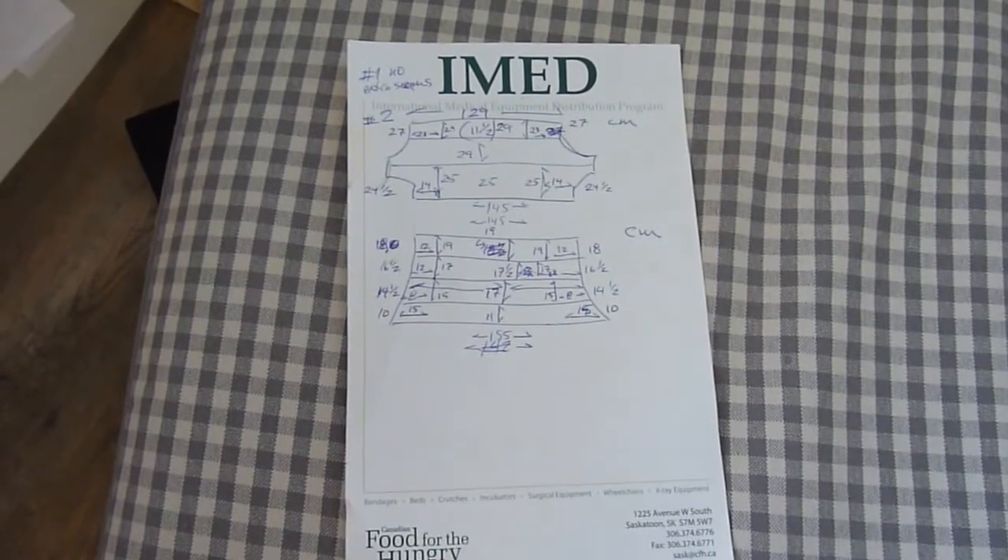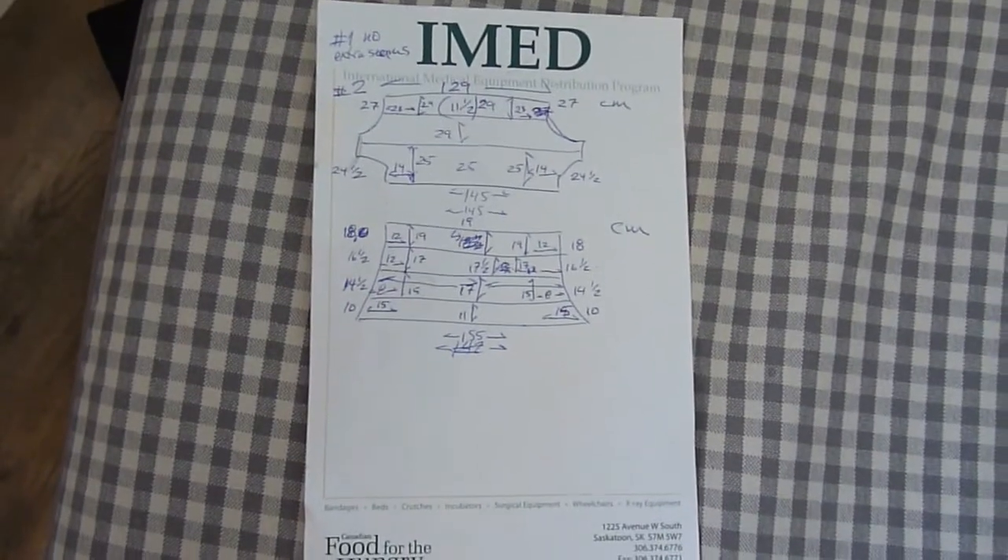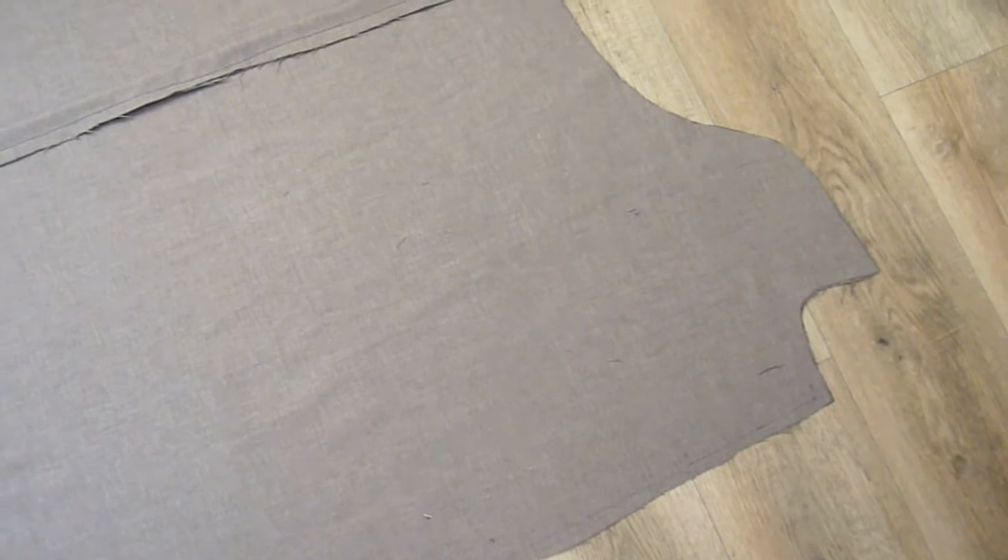Some of the lengths are questionable — we'll see how that works out. I'll remove the pins and flip it over. I took detailed measurements of the headliner from the original — where the seams were, dimensions, widths, and gaps between the seams — and I transferred that to the new headliner. That hoop retainer shows where the line is. I've got lightly drawn ink lines across. I will follow those lines, stitch the next hoops on, and then proceed to piece number three.